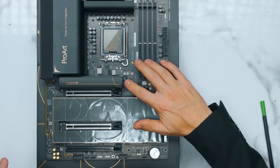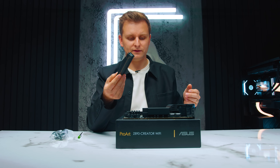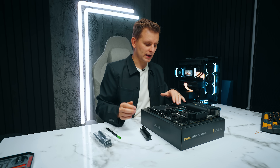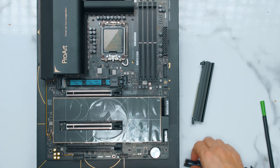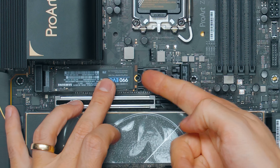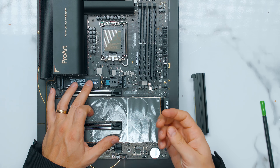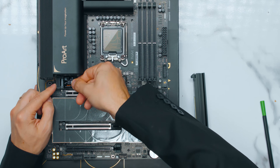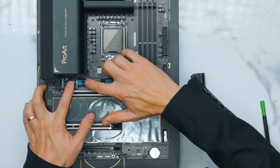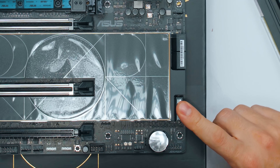There's something interesting going on and I like what Asus is doing here. You just click on this and the big heatsink comes off — it seems very heavy and looks like it's going to cool down your Gen 5 SSD really, really well. They have a very interesting mechanism to actually mount your SSD. So if you've got your usual 2280 SSD, you plug it in, press it down, take the films off the thermal pads, push it into the end, heatsink goes on top — voila, Bob's your uncle. And for a shorter 2230 SSD, you do the same thing — it just goes through the guides and boom. The bottom here works exactly the same. No more screws needed.